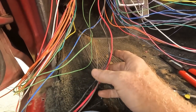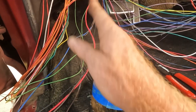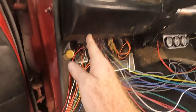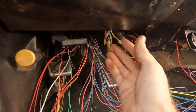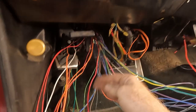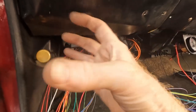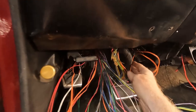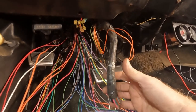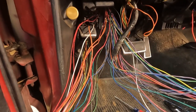I've got some of my headlight switch wires here but it's starting to become a mess. I'm going to tape off the wires so I can trace them back and make sure I get them all separated over onto this side, because they're all going to live up in here. I think I'm also going to make these wires a little bit longer because there's just not enough room to solder all these up. I may end up having to have a little bit longer wire and hopefully find some room. I'm just trying to avoid a big packed maze of wires all taped up and zip tied. The original one was all nice and tight and wrapped up, so I'm going to see if I can get these all taped off and separated.